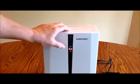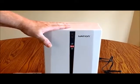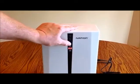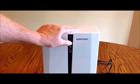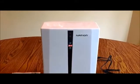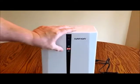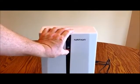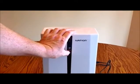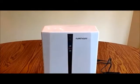You can see when I got to 55, the unit shut off because it says, why should I dehumidify the air when it's already at the target point that you've set me at? I can go all the way up to 80%. So the humidity setting here is between 40% and 80%. Basically, when the humidity exceeds the setting you have by 5%, the dehumidifier will come on. And when the humidity in the room goes below by 5%, the dehumidifier will shut off.